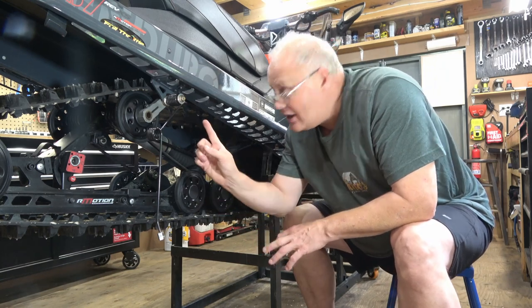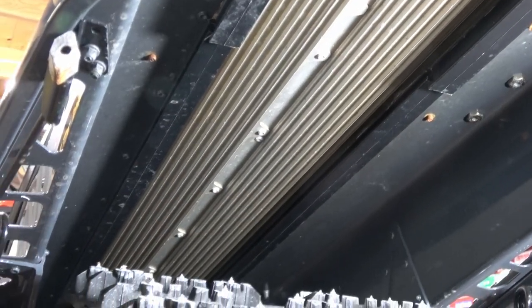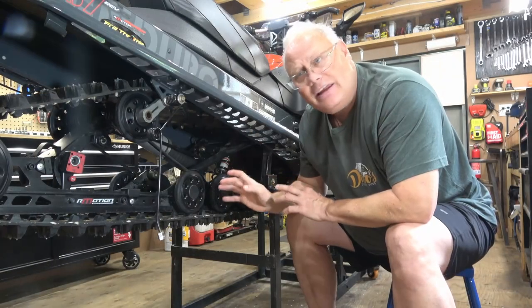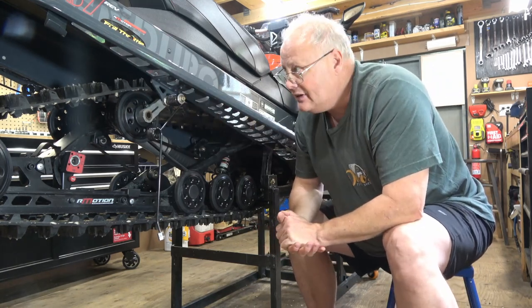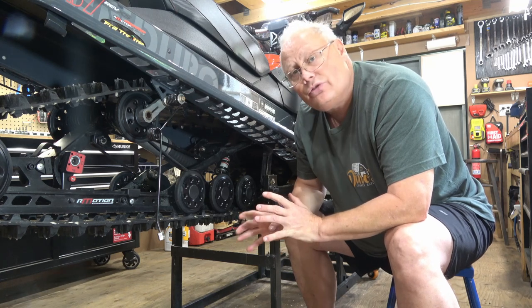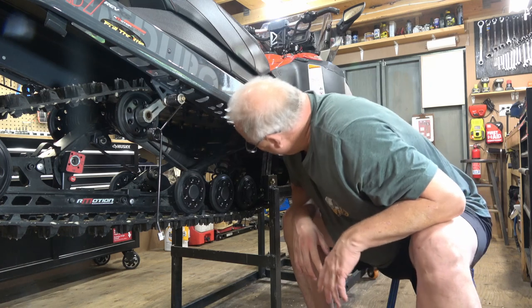I'm also going to take a look up underneath here. This is a liquid cooled machine, so it has a pair of heat exchangers up under there that take the coolant from the engine, and as snow dust comes up and over top of them, it cools the engine coolant and in turn cools the engine temperature. You want to make sure those are in good condition, there's no holes in them, they're not leaking,